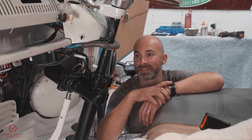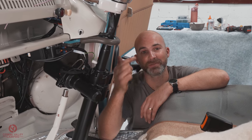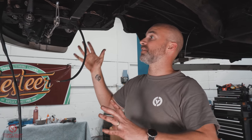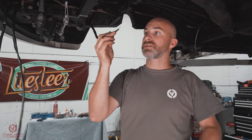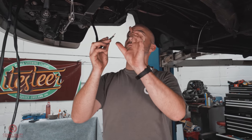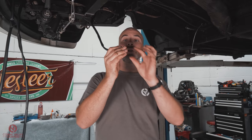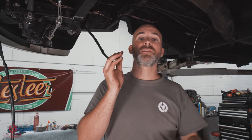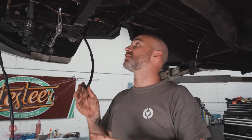But we're nearly there. It's a pretty smart looking unit so far, and I look forward to showing you the rest of the install. We're in the final throes of fitting the entire kit now, and the last thing to do is to route the wiring loom. And this terminal here, once it's routed through, will have a fuse attached to it and then a pigtail on the end of that, which will then locate onto the battery. Ideally, you want to be on the battery.